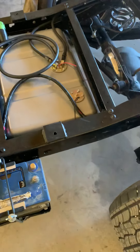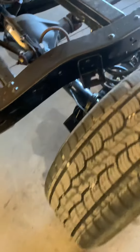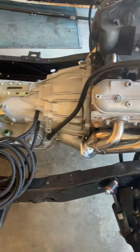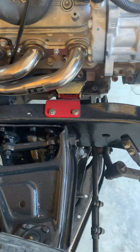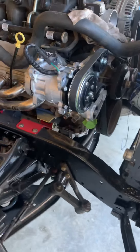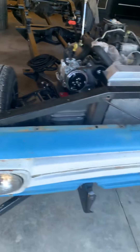I need to get some fuel in it and make sure I don't have any leaks. These are so short — I don't want to splice and then splice again. The 4L65E is just converted to two-wheel drive, everything's looking good there. I've got some short plugs coming. I'm going to have to get those headers off and put in some NGK plugs. I think I've got the hoses figured out — I'll have to cut this one here, seems to route okay, but I need to get the fenders on and cab set before I can get that going.